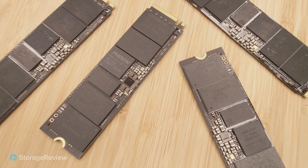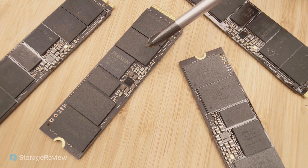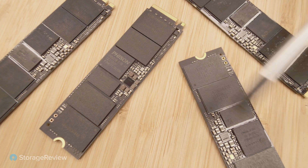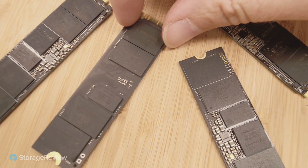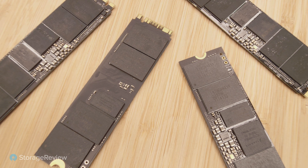There are a couple of different components soldered on, and Kingston likes to use their own NAND pack labeling — the four NAND packs on the side are silkscreened with the Kingston brand name, as well as their DRAM pack. Then you get your tried-and-true Phison E18 controller. One interesting area is on the opposite side of the board: they're one of the only ones that don't use all the M.2 traces. You really have to break out a magnifying glass to find differences between these SSDs, but in aggregate those differences do make this drive a little bit different from the other E18 drives.